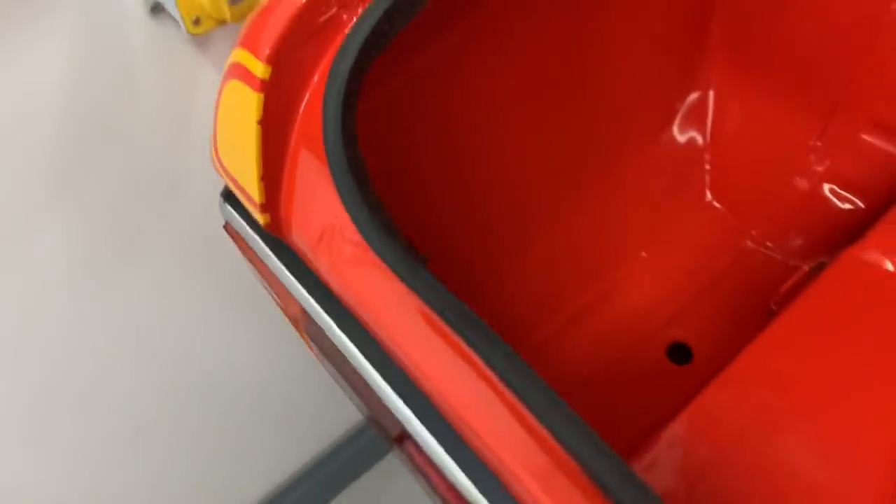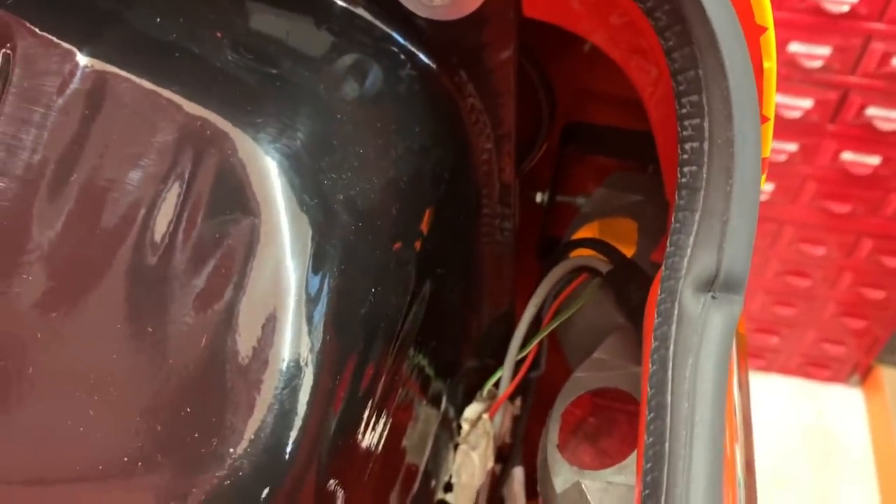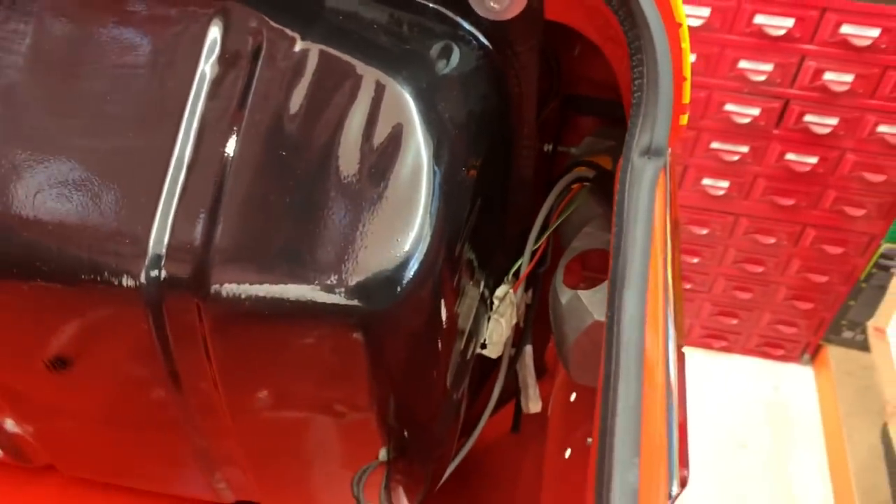There are the brackets fitted onto the rear light unit. I've fitted little rubber feet to them so we're not having the edge of the metal bracket sitting against the body — there's now protection between the two. We've got spring washers as well so they won't come loose, and that's pulled the light units in nice and tight. It wouldn't be as awkward to access the other side if I took the tank out. But for a couple of hours' work, I've saved about £34 compared to buying them off eBay.